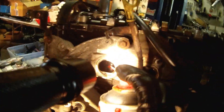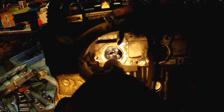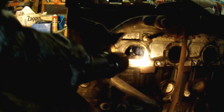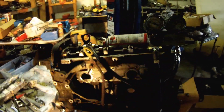So we're going to look inside the exhaust and see if we can verify it. Here's the exhaust — spray a little cutting oil in there and you can see the air escaping through the exhaust valve, and also from this exhaust valve. By simply testing, you can identify whether it's an intake valve or exhaust valve.